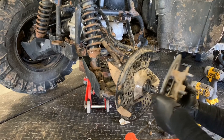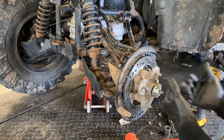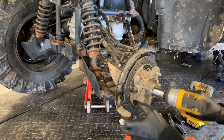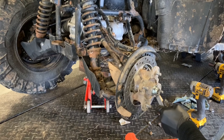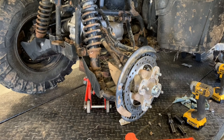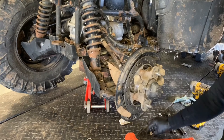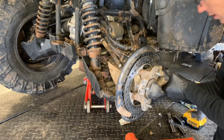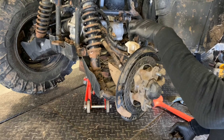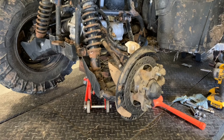Go ahead and take our hub and slide it on there. Make sure our axle pulls all the way through. When we tighten up this nut, the axle will get pulled the rest of the way through. Take our inch and a sixteenth socket and snug that up, then take our chisel and put a dent in that axle nut to lock it. Put our cap on so we don't forget it. Then slide the caliper on — all of this is going to be exactly like our other videos on the rear axle and wheel bearings. Get the caliper bolts tightened down, the top hose clamp and guard tightened down with those two 10 millimeters, and the center nut tightened. All that's left is to put the wheel on and tighten the four 17 millimeter lug nuts.